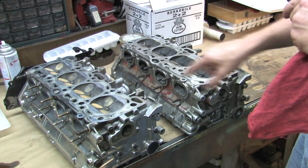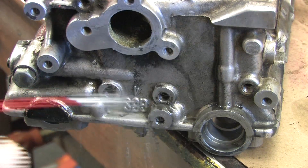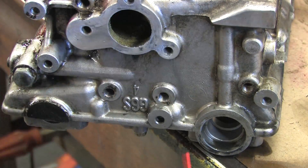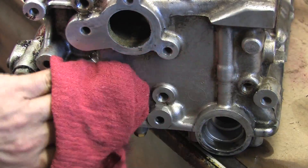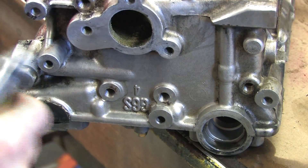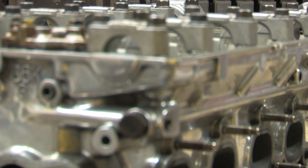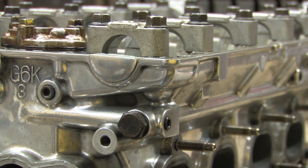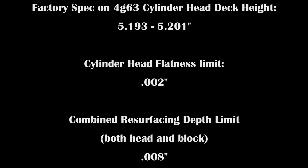There's some variance in the depth of this oil port just from the factory — a 28 thousandths of an inch variance in castings could have a dramatic effect on oil volume, especially when aftermarket fasteners are introduced. Had the G6S head been milled 20 thousandths, the oil port volume would be half of this G6K when new. I can't find a printed specification for oil port depth, but I'd estimate it should be between 73 and 101 thousandths of an inch — the stock depths of both castings. If you remove your balance shafts and raise block oil pressure, I'd recommend the fatter side of that measurement whether or not you have lifter tick. If your short block is stock and you never had lifter tick, you should be able to get away with anything in that range.